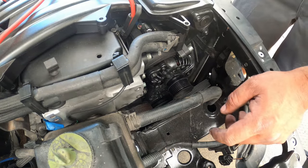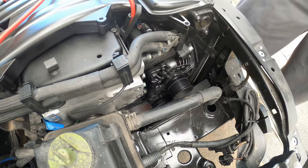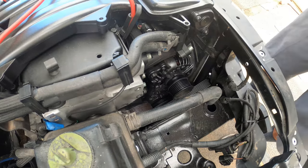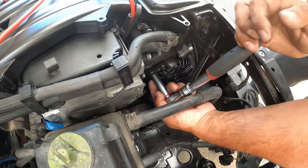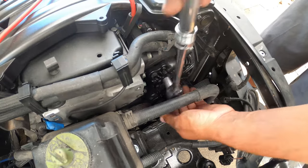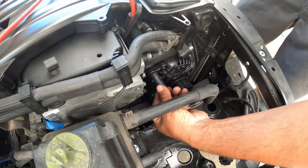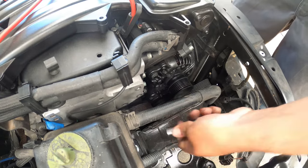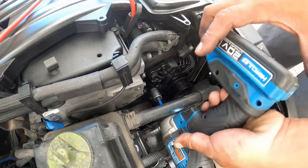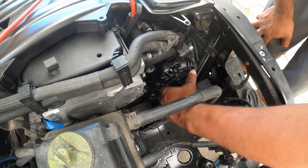Now with removing the tensioner, it reveals pretty much the two 13s needed for the alternator — one here and one here. I need a short 13 for that. I got the bottom bolt removed; top one's next. Sometimes they're a little tight, sometimes a little loose. A little impact gun here will get it out fast — thanks to McDubbin. There we go, nice and quick. You'll see the alternator pretty much fell right there.